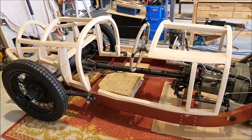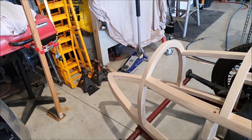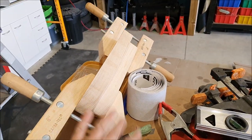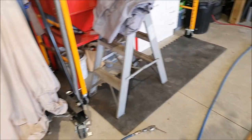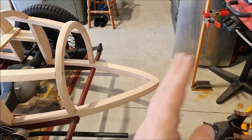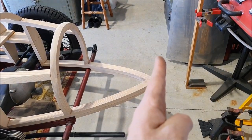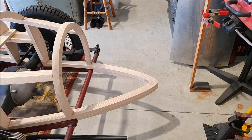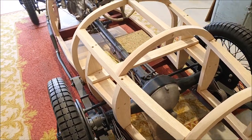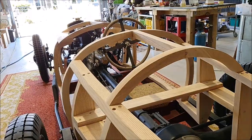I've put the frames back on the chassis and added in the timber across the top, and I've started making the tail - the block that becomes the tail is just a couple of pieces glued together that'll all be shaped. It's cut on the right angle so that the tail is not perfectly vertical - it's actually tipped in just a fraction so that it looks vertical. If you have it directly straight up and down and get it wrong it'll look very wrong. With the rough shaping done, you can see how it's starting to look like a car now.